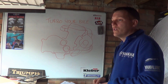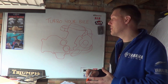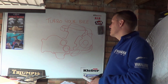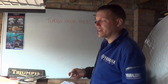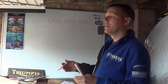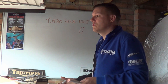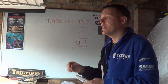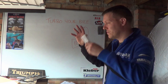So that's all that. The next thing we are going to look at is the fueling considerations — these are just basics that you have to start thinking about before you jump knee deep in. There are two separate instances: fuel injection and carburetors. The fuel injection side of things is actually not that difficult, especially with a lot of aftermarket options. You need to get power commanders and different ECU systems. You can use the injectors already on your machine or source different ones. You need something like a PC2 or PC3 so you can adjust the air-fuel mixture ratios and account for the fact that you no longer have an O2 sensor. There are a lot of forums where guys who have done this before can teach you about that.